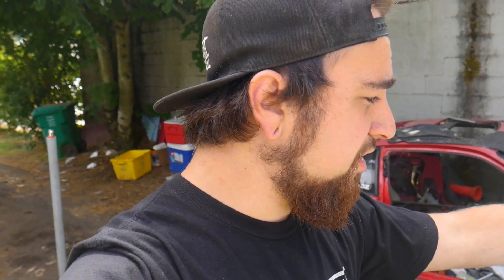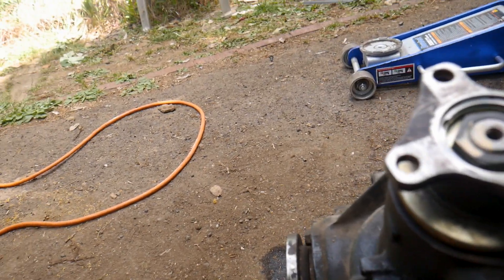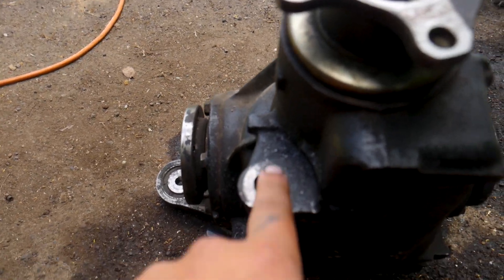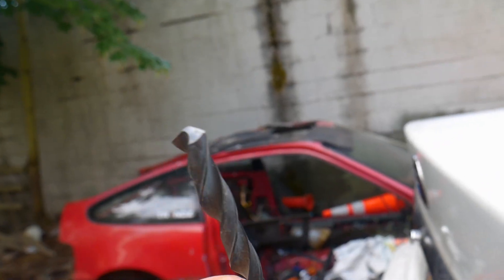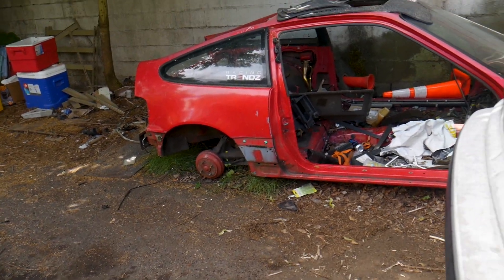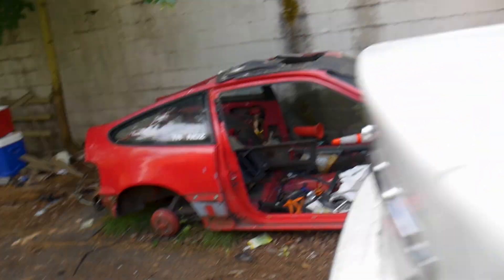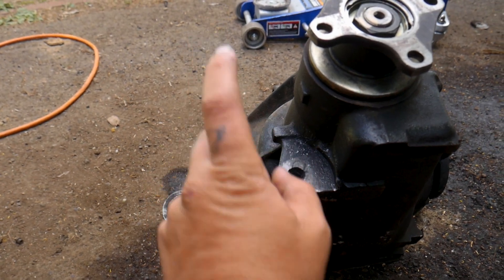It's currently the next day. I got the half-inch everything. The bolt in here is pretty seized - it ain't coming out. So I got this big drill from Reed's grandfather next door with a half-inch bit to drill that out, and then a half-inch tap and die tool. Then we're gonna get a high-grade half-inch bolt and a lock nut to put on the back side, and hopefully that works.